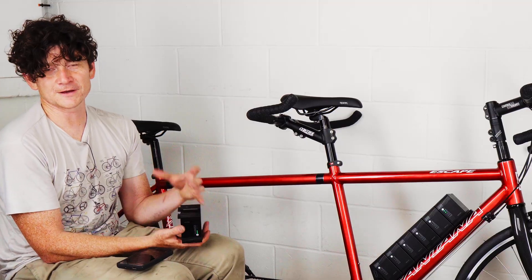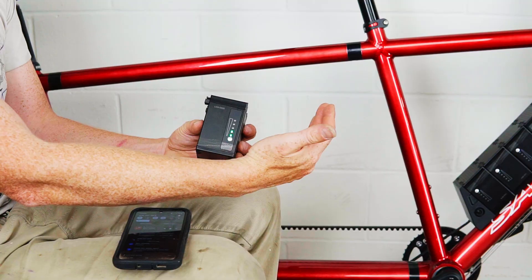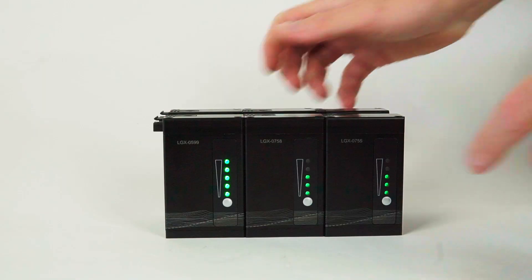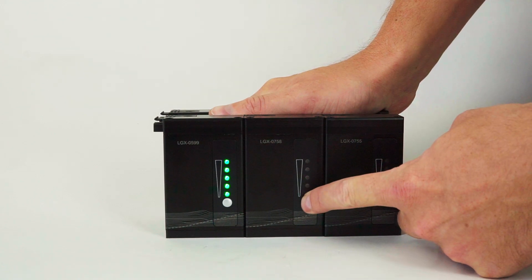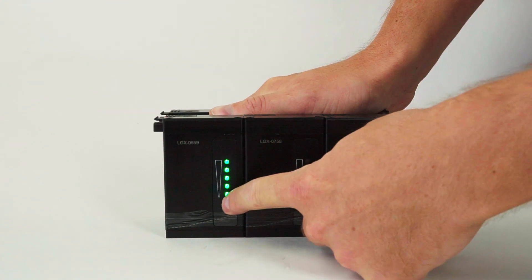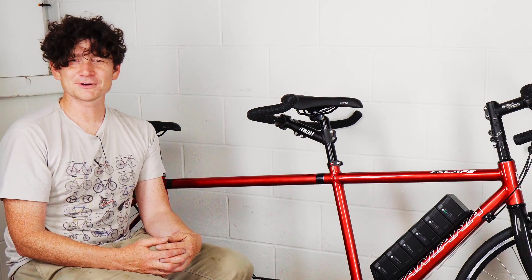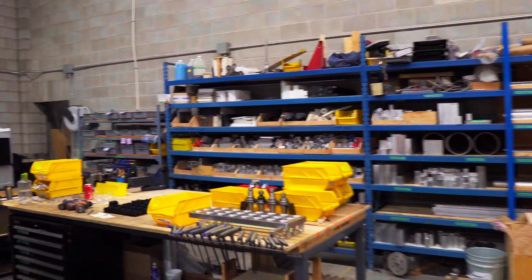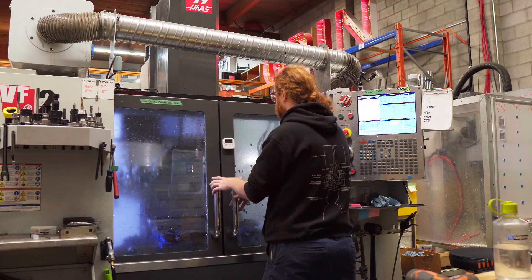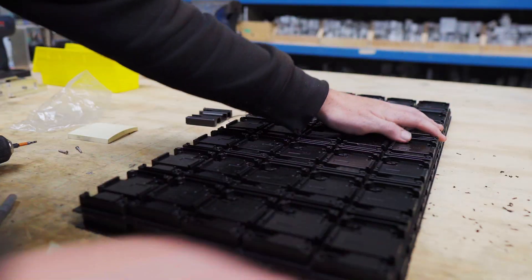This mode is useful if you have one, two, or maybe three modules. But you do have to be careful, say you have three LIGOs, that you individually turn all of them on or all of them off at the same time — there isn't the means in the current firmware to automatically synchronize the on/off behavior across all the batteries. We hope you found this short video informative. We're really proud to finally be launching the LIGO 10X battery modules in a formal sense, and this is its first stage release with a lot of opportunities to build on this platform as time goes on.